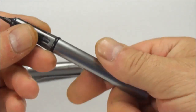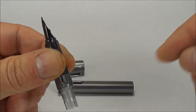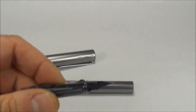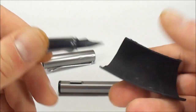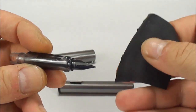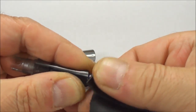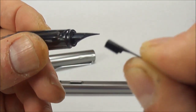What we're going to do is show you how to dismantle the pen. This particular pen actually came with a little ink cartridge like so. I believe you can actually get Lamy converters for these pens as well. The feed and the nib will all come apart. What you need to do is get your trusted — I use a bike inner tube, cut into squares like this. Excellent for actually removing parts and it doesn't damage any of your parts. If we just apply a little bit of pressure on the top there to the nib, you see the nib actually comes off like so. It just simply slides off.